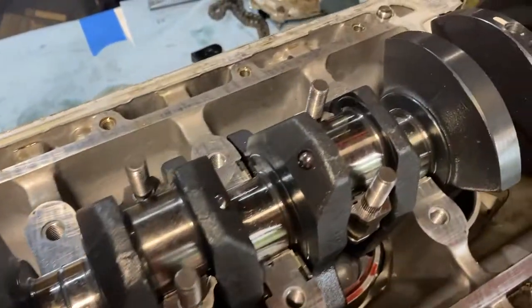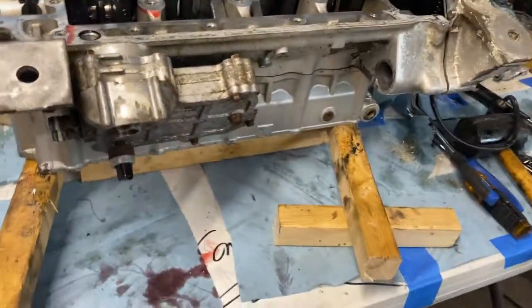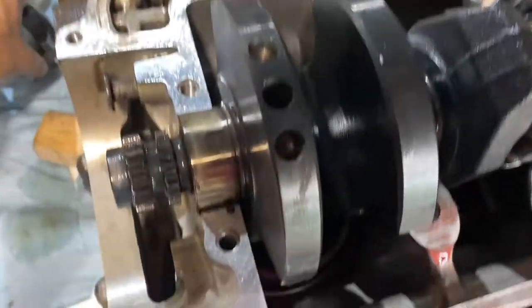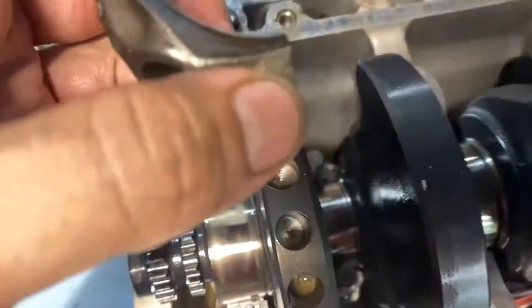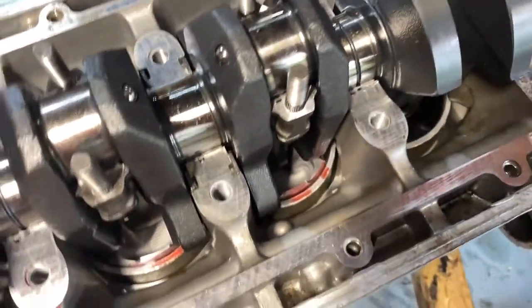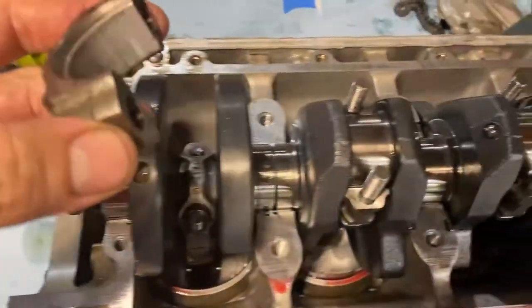Guys, so as you see, rods are all in, pistons are in, lock sitting on there good. Got to be sorted on there to hold them so they don't fall out. So what I'm gonna do now is start putting the rod caps on. Basically, the grooves with the bearings there line up with the groove on the other bearing. Well, not line up, but side by side. You get my drift. Yeah, we just go like that and pop them all on, and go from there.